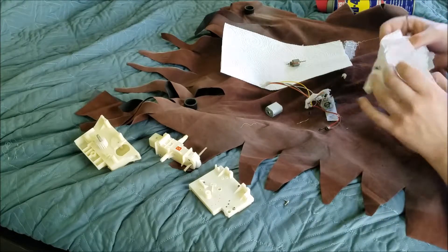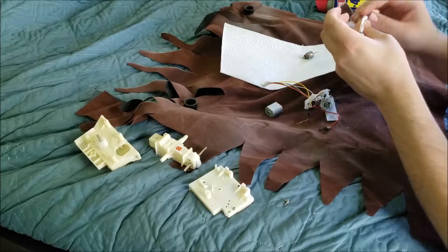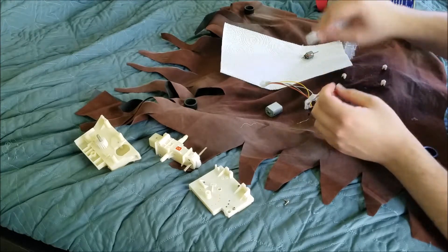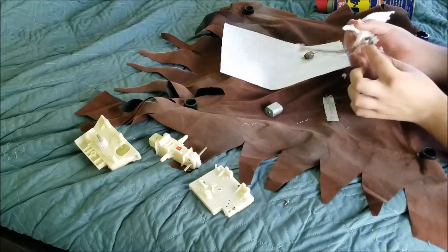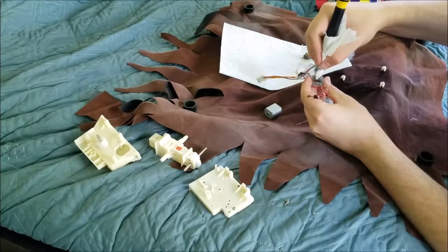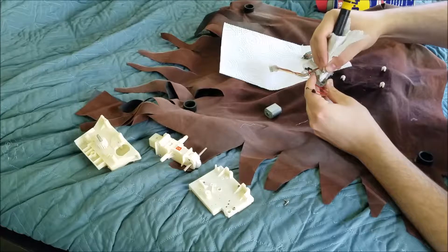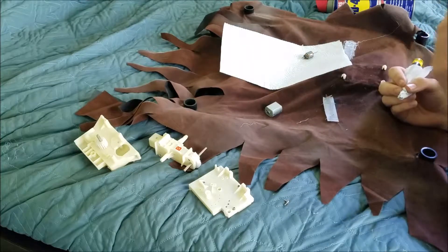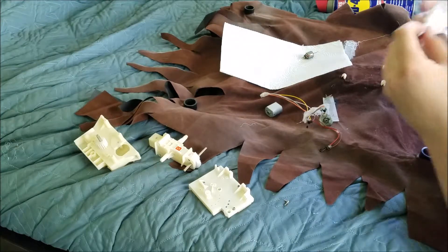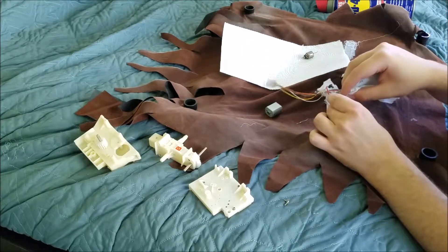Take your paper towel and a screwdriver, put it like this, and fold it over — fold it down on the sides, and it'll form kind of like a little brush-cleaning thing. You're going to want to go inside the brushes right here — here's what the brushes look like; they're all dirty and nasty in there. Take your screwdriver, stick it right in the middle of the brushes, and just rub around on top of the brushes very slightly. You don't want to break the brushes — if you break the brushes, the motor won't work. Look at all that junk coming out — these motors build up a lot of junk. Repeat the same process until you don't see a whole lot more dirt coming off.